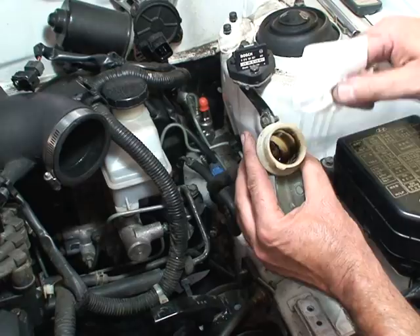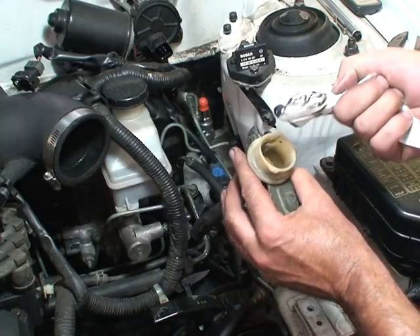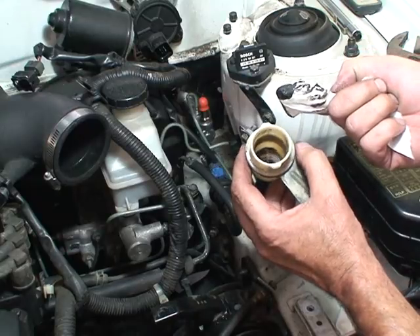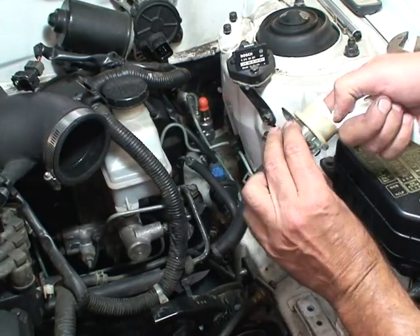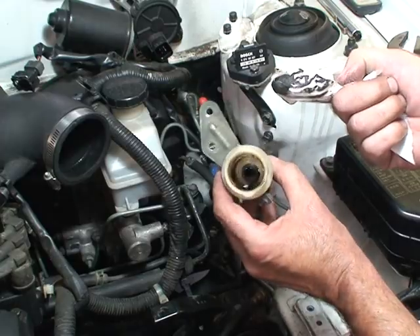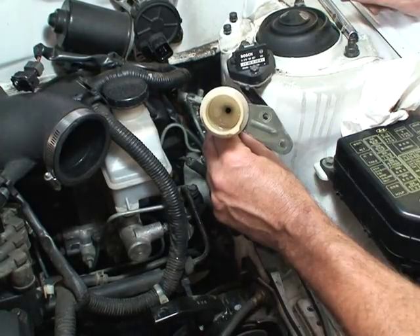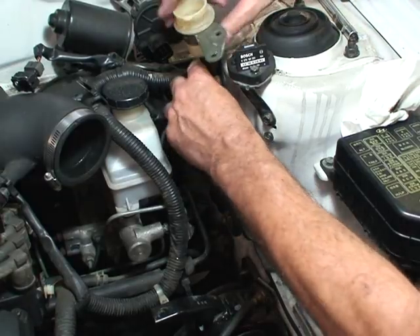Now, this will help people understand about changing brake fluid every so often — this is just full of black sludge in the bottom. I don't think this fluid has ever been changed out. So before I install this reservoir in line, I'm going to clean these two out. A lot cleaner in there now — that was ten-year-old grunge.